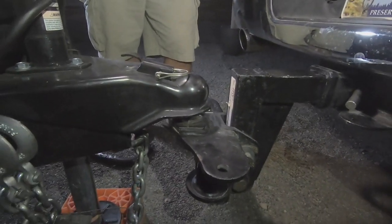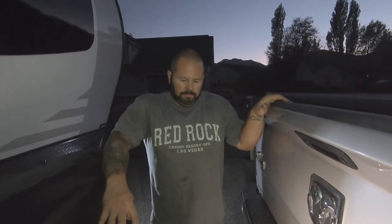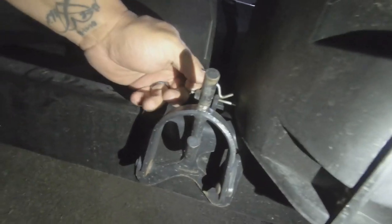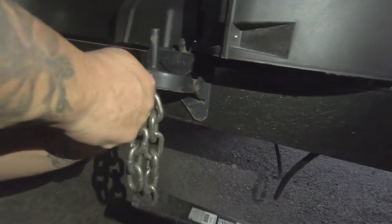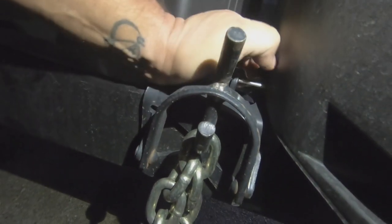Now we're going to raise it back up for our weight distribution hitch. I don't like to fight the bars trying to pull them up, so what I do is raise the truck up where the bars simply just slide right on — this is faster, easier, and safer. Once you start to hear the jack struggling a little bit, we're probably good. Take your bar, locate the hole down here in the bottom, push it upwards until it snaps into place, then slide it back. Remove the pin, pull the latch down, and I do five links — one, two, three, four, five — and that's where I hook it up, on that fifth link. Pull the bar back into place and reinstall the pin. I did the exact same thing on the other side.